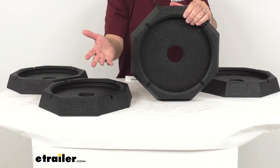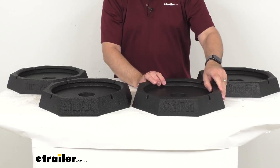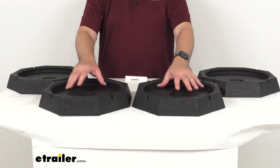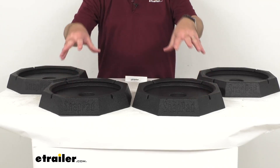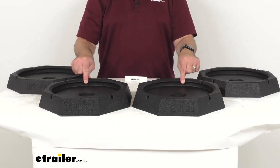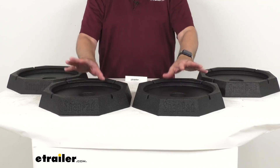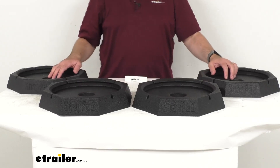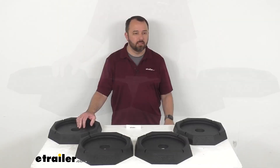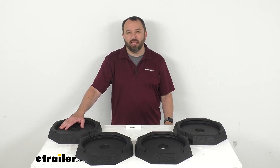There's not going to be any need to remove and replace these pads or carry other jack pads or blocks around with you. This is really going to be a simple one-time installation — you're just going to line up the pads beneath your jack feet and lower each foot until the lip on the pads fully engages and locks into place. You'll actually hear a snapping sound once the pad is securely installed. Installation will then be permanent, so once you have the snap pad secured, you're never going to have to worry about crawling under your motorhome to place pads again. Well, that's going to conclude our look today. I do hope it was helpful. My name is Andy — thank you for joining me.